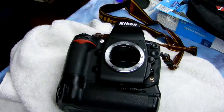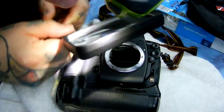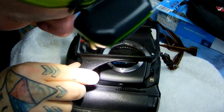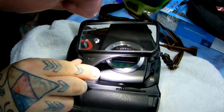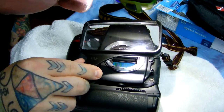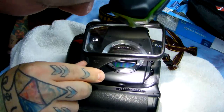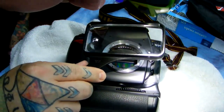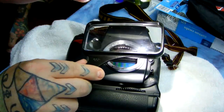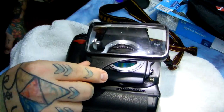Now I'm going to take my previously cleaned magnifying glass and look in at my sensor. I still see the dirty spots that I saw from my test shot beforehand. There might be a little oil streak right there. I'll tilt my headlamp up and look at the other side. There's no need to buy a $40 sensor loupe to do this — I'm using a very clean magnifying glass and I can still see the spots and smudges that are creating the defects on my pictures.